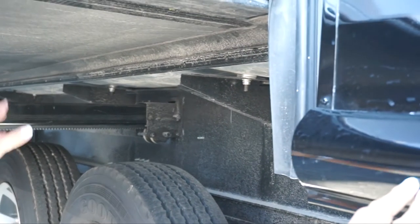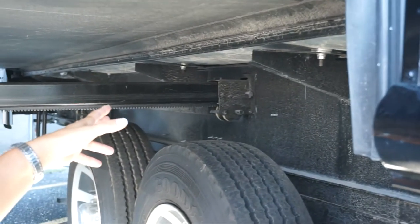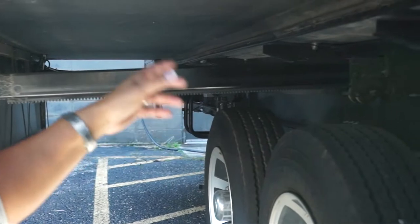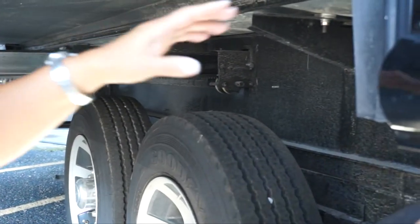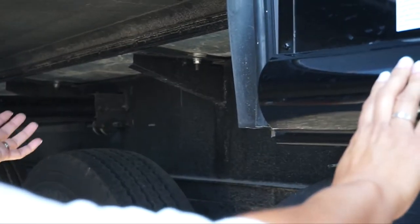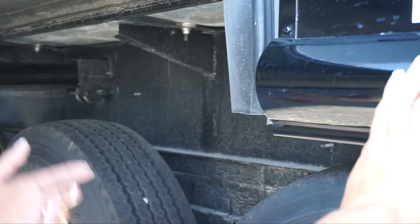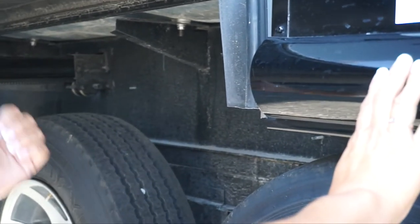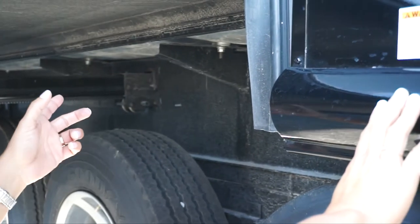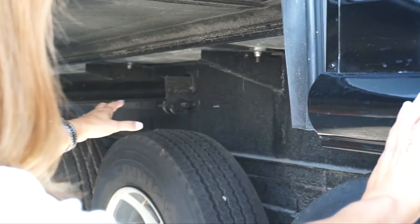We use simple gear-driven but electric slide motors. For a full-timer, that means easy access, easy maintenance, easy repair. If this was hydraulic, you would have to have a special hydraulic tech come out. With the electric slide motors, most likely that service center or tech already has that slide motor in-house — knows how to change it, knows how to get to it. It's a simple and easy repair versus maybe waiting an extra day or two for a specialized hydraulic tech.